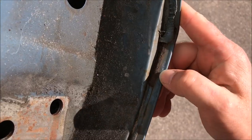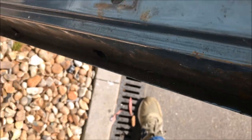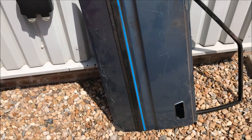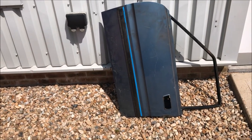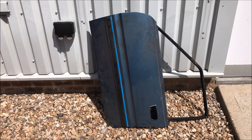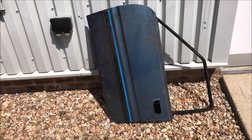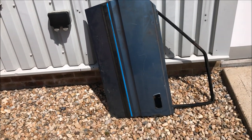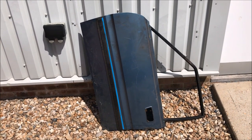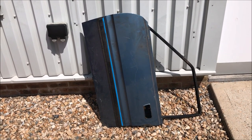There's a bit here where that flange is blown, but that's not a big problem. The bits that usually go are all fine along there. So I'm going to carry on with my preparations for the sill, knowing that I can bolt that on, gap it nicely to the door frame and the remainder of the front wing and that rear near side door. Then I've got a nice straight edge to measure up to when I'm adjusting my sill before I weld it on.